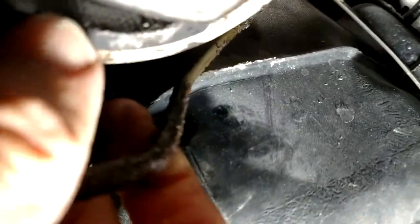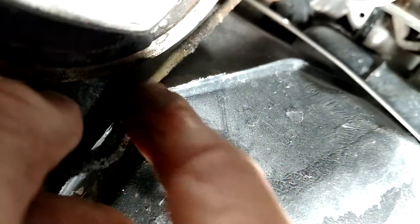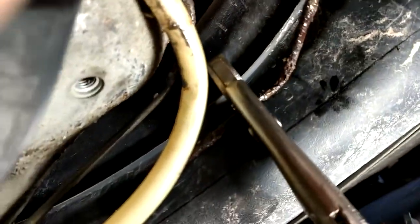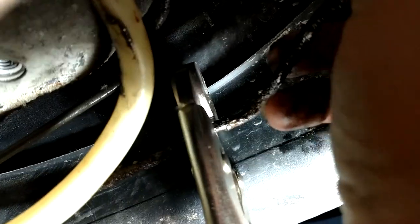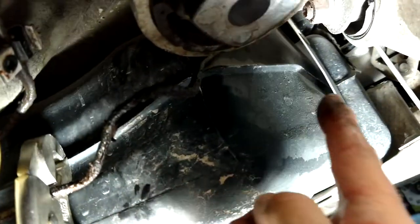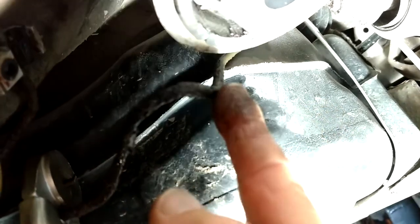Up here is up by the left side fuel tank. It's grimy, but it's actually in good shape. Basically here is a good section that I can connect to, but right now there's not really any way to get to what I need to get to. My plan is to cut the line here, leave it clamped off so I don't lose a lot of fluid, install a splice in this section first, and come around with my spliced section to figure out where I need to put the other end of the splice. To do that, I'm going to bend this line out into the area here so I have enough room to swing a tubing cutter and get my flaring tool on this line.